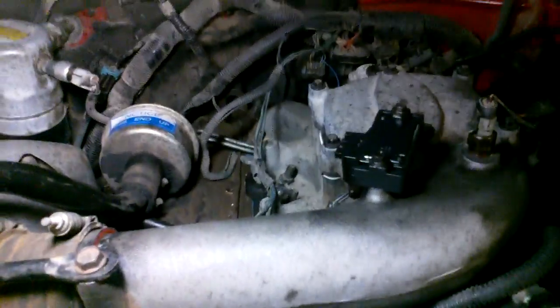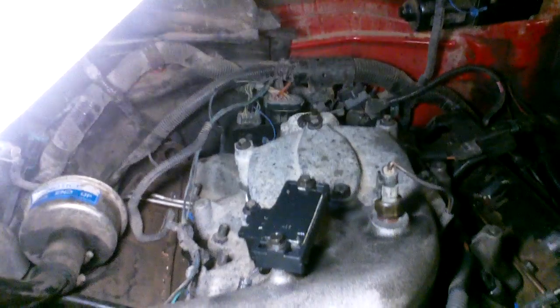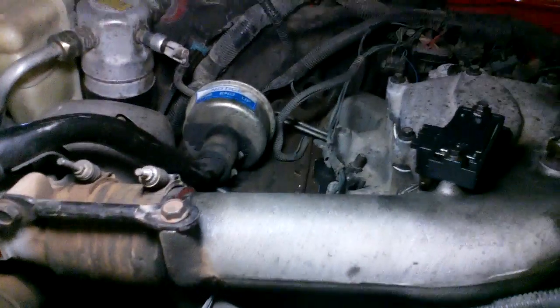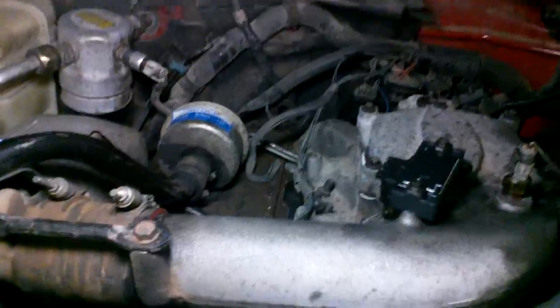And when it did that, the mass airflow sensor, sorry, was actually saying that there was no flow, so it threw the engine code. Well, I tightened that boot up, fired it up, and boy, she just runs like a dream. Just smooth, just sounds great. I mean, it's actually even quieter than the other diesel was that had all the blow-by. But guys, I'm extremely happy so far with it.